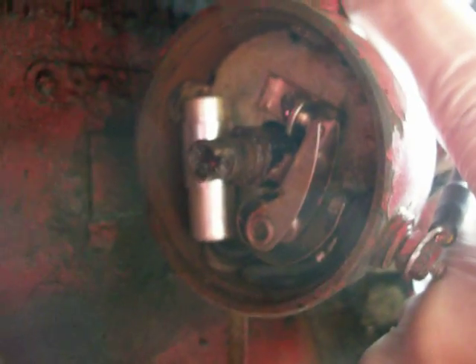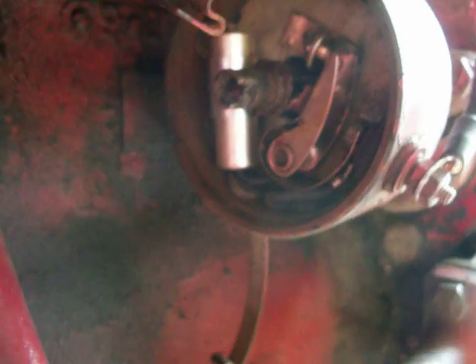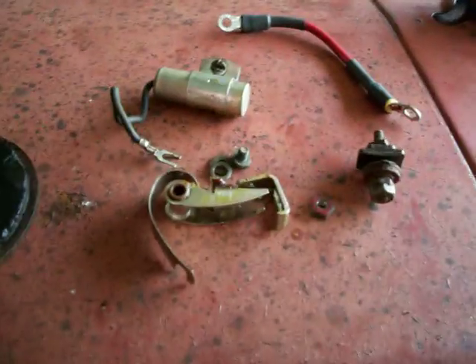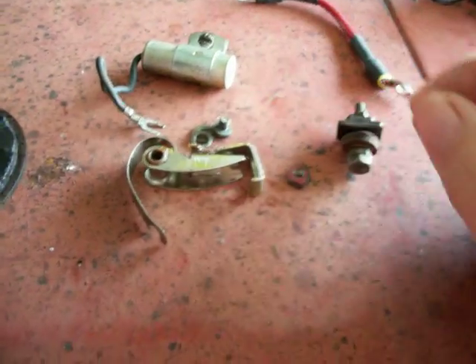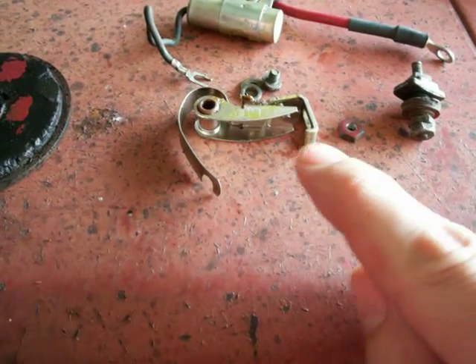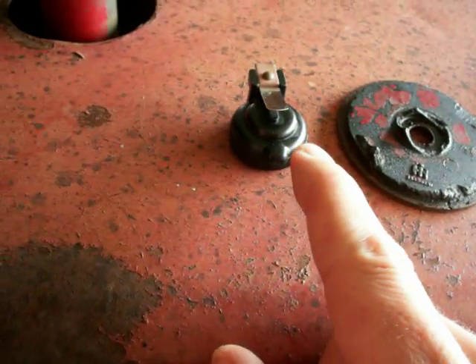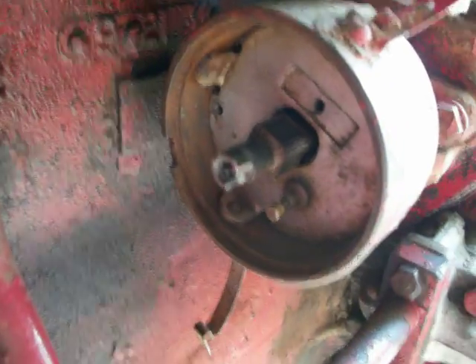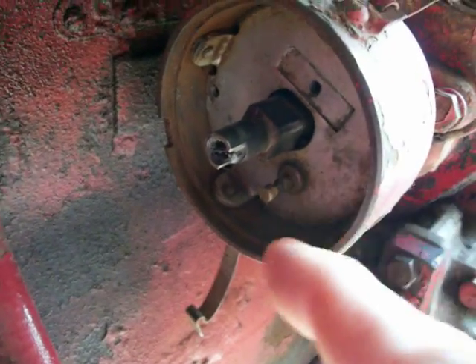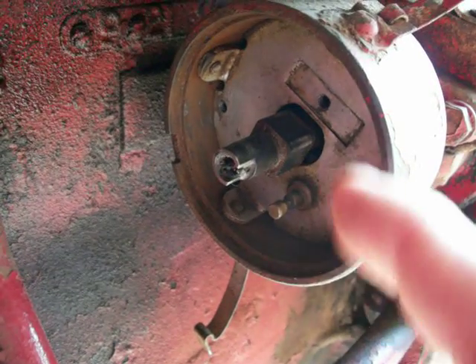There's grub in there too. Now we've got to take out the condenser and take off this armature as well. We removed the wire that came from the coil to the lug, removed the lug completely, the insulator from the distributor, the points, the condenser, the cap, the dust cap, and the rotor. Now we are in the guts of it — we've got a nice clean hole here, and we've cleaned this up as well as we can on the inside.